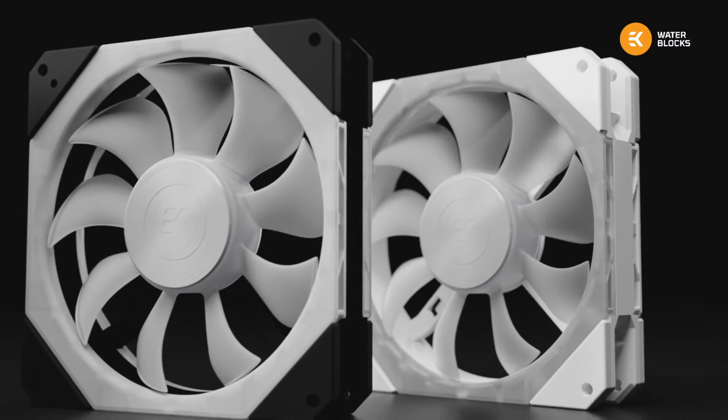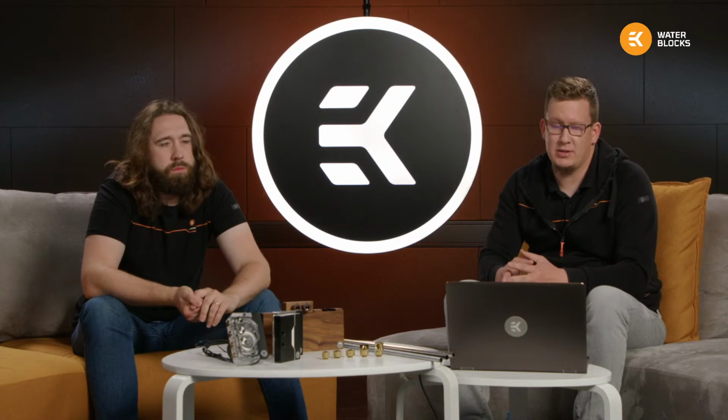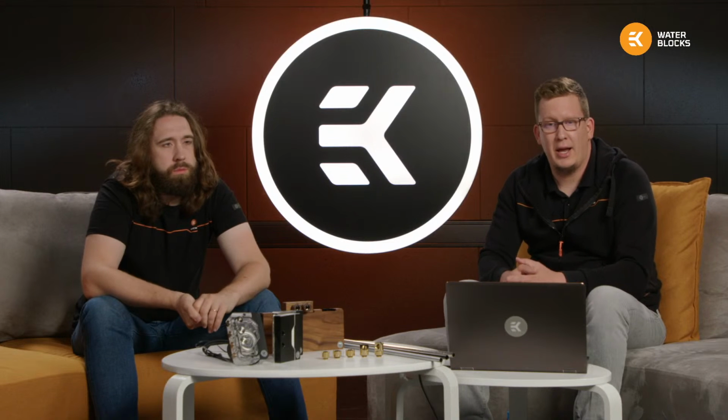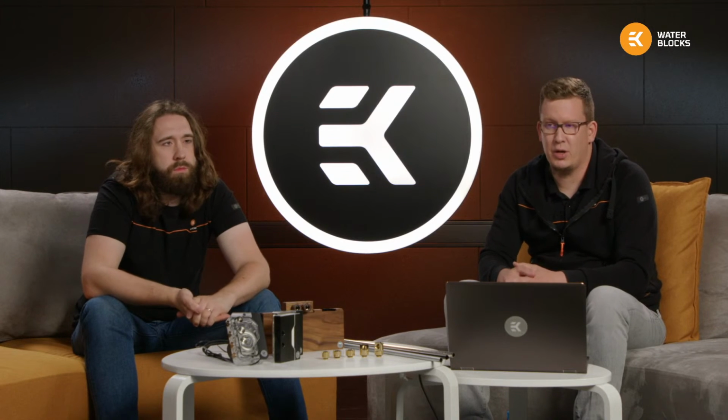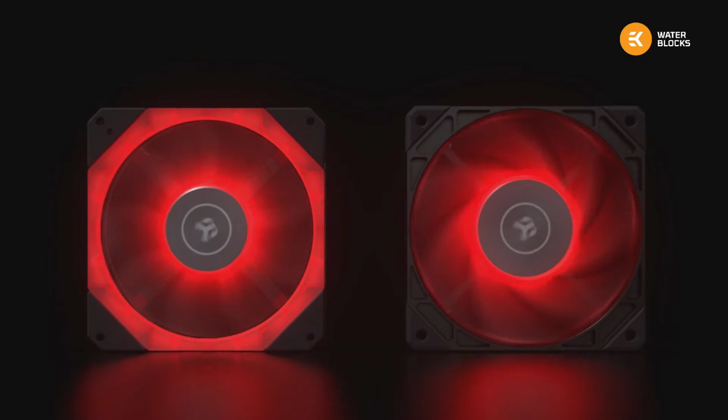Regarding the fans, we will have two types of fans, because some of the customers want high performance and some want full-on RGB, so maximum RGB for the fans. But if you implement RGB illumination in the frame, that means that the fan blade has to be a bit smaller, which means that you lose performance, and this is why we have the high performance fan, which has the biggest possible blade for the frame size, and we have the RGB version.